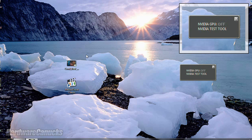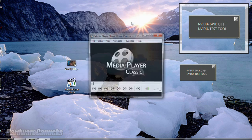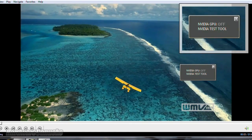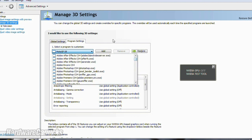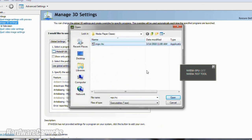However, if you know you're not going to be needing the video card, the software does allow you to specify which graphics processor you want to use. Here you'll see we can opt to run the media player with integrated graphics. When the video loads, the NVIDIA GPU will not engage. The Optimus system uses a profile setup to determine what should and shouldn't turn on the video card. You can see under the control panel that there are hundreds of different games and applications supported, and NVIDIA is constantly automatically updating and downloading new profiles for you. But if you do want to add specific rules for an application — in this case our media player — you do have the option.